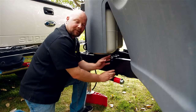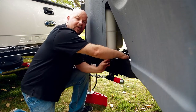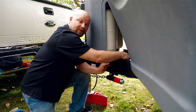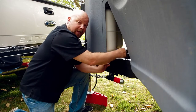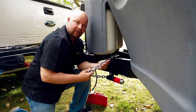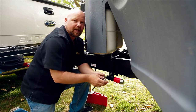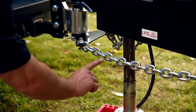Now that we have the brackets in place and you've pulled back on the top to get tension to the chain, we want to check to make sure there are no obstructions, wires, or anything on the inside that will pinch or be in the way. If there's something you can't move, you can shorten or lengthen the chain — either with our kit that adds six more links, or by cutting off links. If you do need to cut off some links, make sure to cut from the triangle plate side in order to shorten the chain.